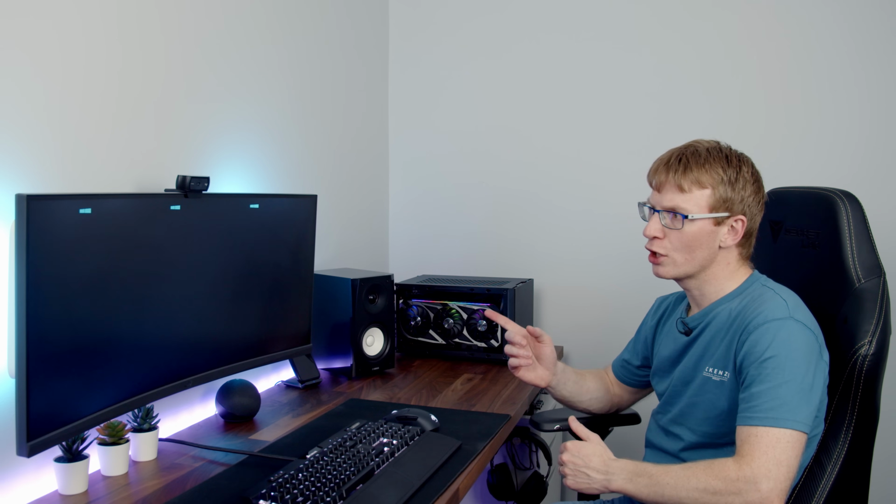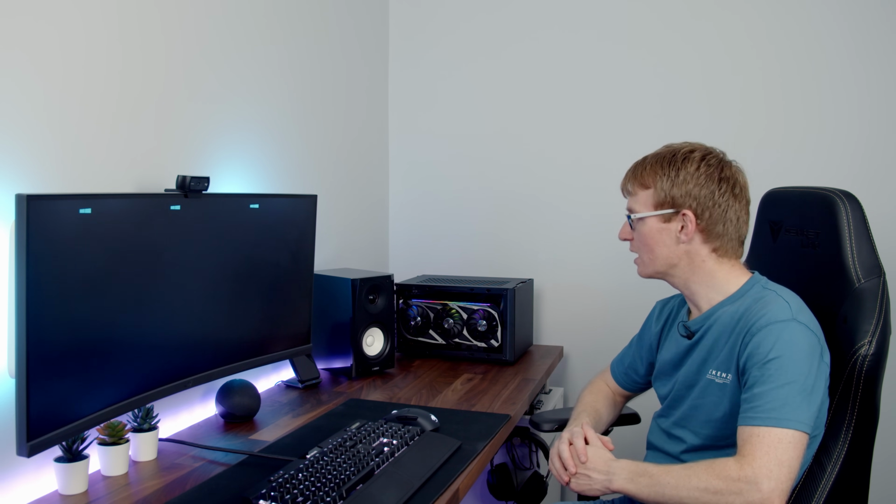So what we're now looking for the computer to do is find the Windows bootable drive in the back of the PC. If it finds that, it'll boot off it because importantly the SSD that we've installed doesn't have any operating system in it. So the next thing we'll be looking for on the screen is the Windows installer screen, and we can see the Windows logo, which is a good sign, and we're through to the Windows install screen.